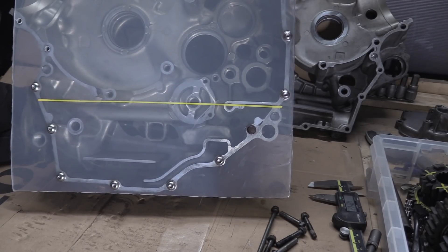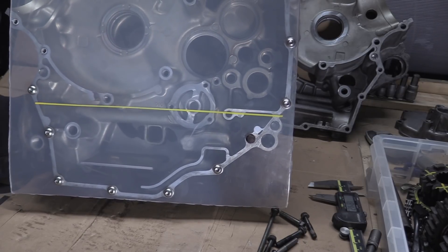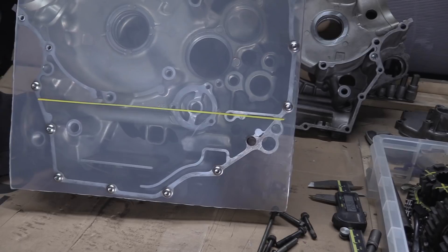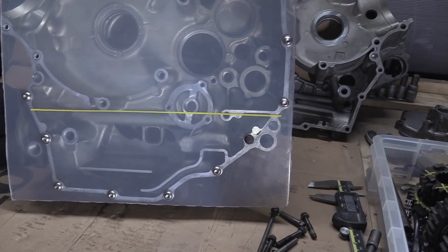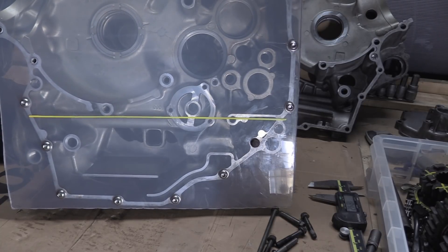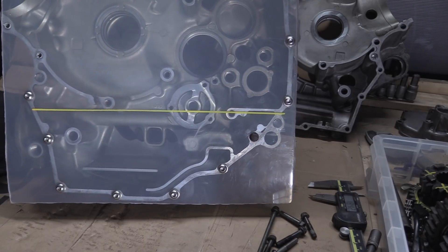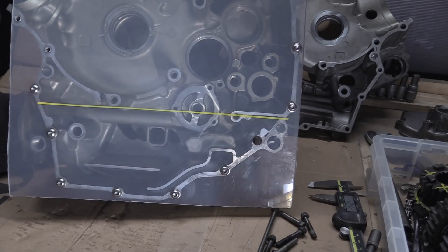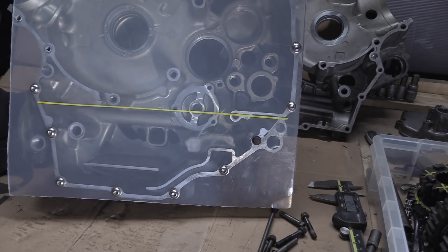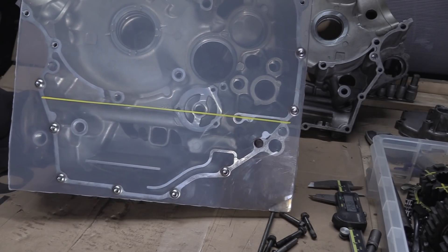Usually when you're on the front wheel you're off the throttle. I just wanted to do a fluid version so we could tip it back and see. You can actually even see where the main feed pipe is in the back, just below the line — that's the feed pipe from the pump to the filter. This isn't filling up with fluid; this is just transferring that full/empty gauge on the other side of the crankcase — on the clutch cover — over to this side.